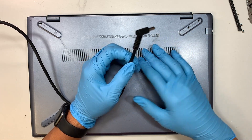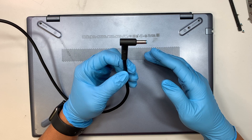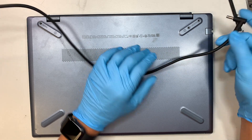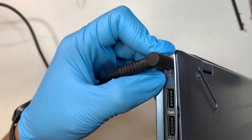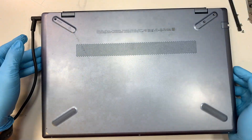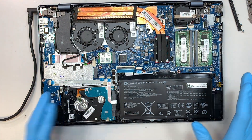If you keep your laptop stationary on your desk and you're not traveling with it or moving it around, the chances of you disconnecting the charger are almost zero. When you leave the charger plugged in, the amber or white charging light is always on — always charging the battery. This is the reason why you've killed the battery prematurely.